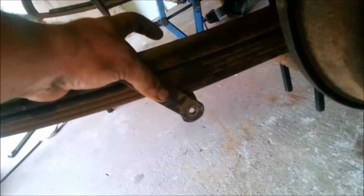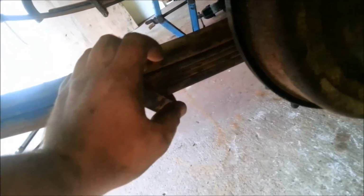This one here, I'd recommend, if you're doing the same sort of thing with the same sort of spring setup, keep your bottom leaf, because I didn't think about this before, but it made sense when I started to put everything together. These are here not so much to stop them expanding out. You can see how much gap there is there. I think from my fabrication experience and common sense, these are to keep the leaf springs from flaying outwards and going to shit. So keep them there. It just makes life easy.